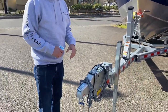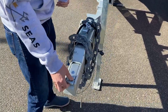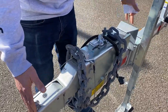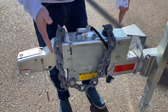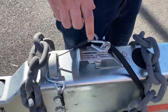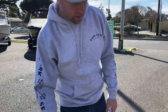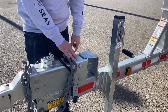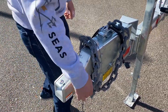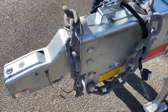Right here is called the coupler — all trailers have it. This is the coupler latch. This has got surge brakes on it; they're called surge brakes. What happens is it compresses and pushes the fluid down. These have a brake lockout, so there's something called a brake lockout on most trailers. This is a safety brake lockout where if you're going along and it fell off, this pulls it and it locks the brakes up. You have your safety chains right here — you always crisscross them so if it fell off it would cradle and catch it. This is the coupler pin, the coupler latch pin.